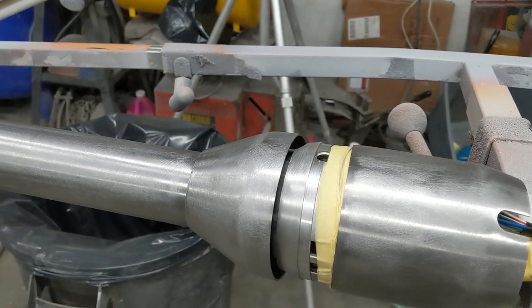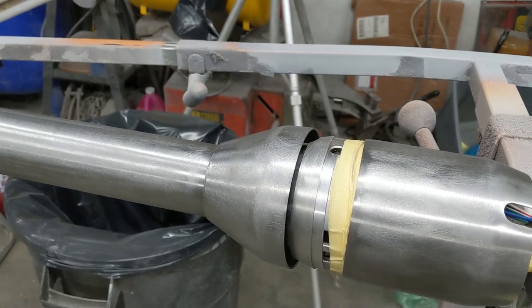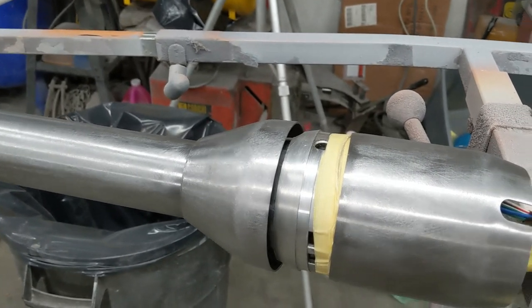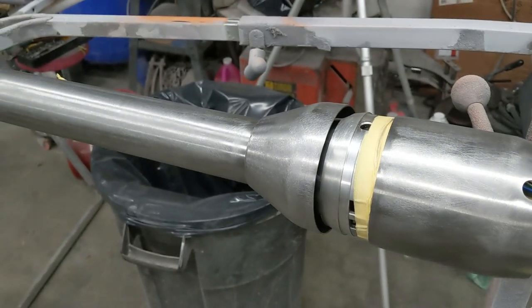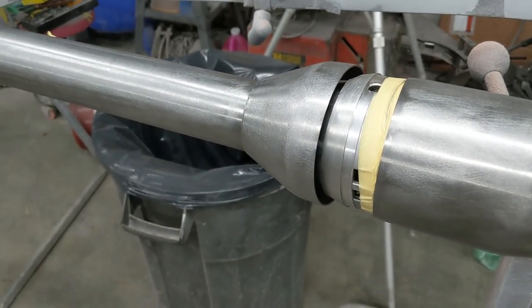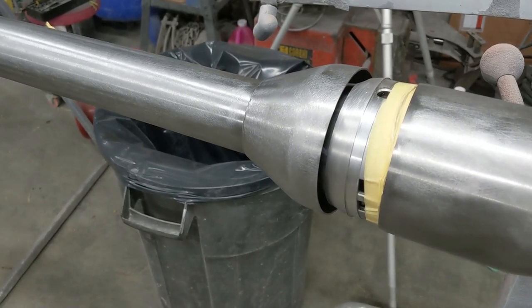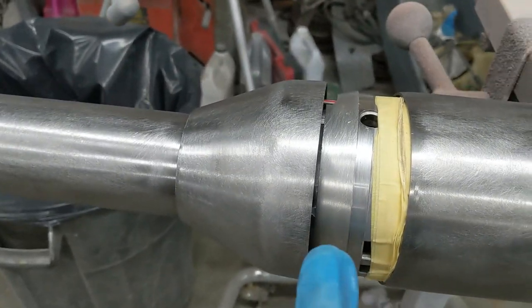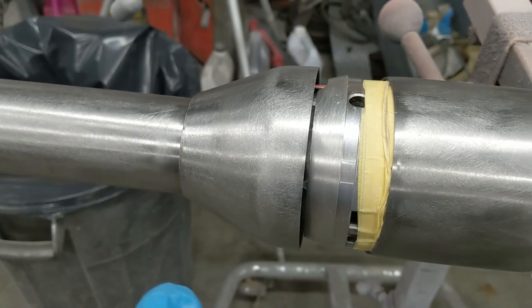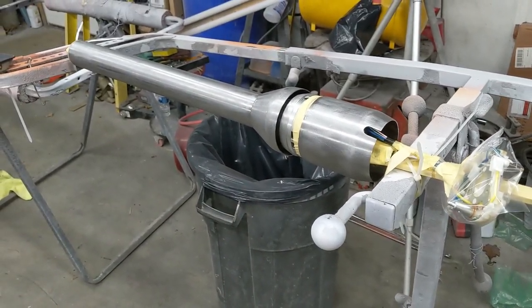That's why I say get you one that's painted or chrome. Because if you don't want to deal with that, now granted, you can do it however you want to. But if those little things like, oh man, that steering column is brand new and it's painted right to that point and there's a shadow and it's either not painted or the clear is inconsistent or the finish is inconsistent. That's because they didn't pull the column apart to make sure that this piece is out far enough so you can get paint all the way to the edge. All right, enough of my ranting about the steering column.